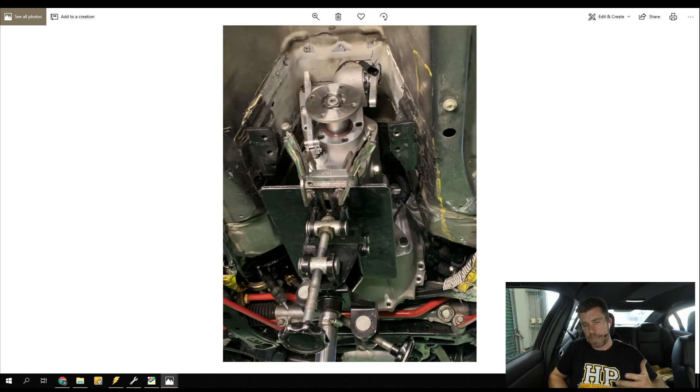What's not quite so great is that as soon as we lifted the gearbox into location, we found that the protrusion at the top of it was going to foul on the underside of the transmission tunnel. There is some bracing there that just perfectly coincides with where it needs to fit. We've got the car at the fabricator at the moment - on the laptop screen we can see where we're at. The gearbox is lifted into place and there has already been some cutting to remove the bracing from the transmission tunnel. This almost gets us close enough, but the gearbox is still touching the top of the tunnel, so there will be a little bit of cutting and boxing of the transmission tunnel needed to give us enough clearance. Fingers crossed, once that's done everything else should be pretty plain sailing.